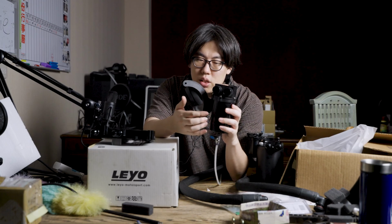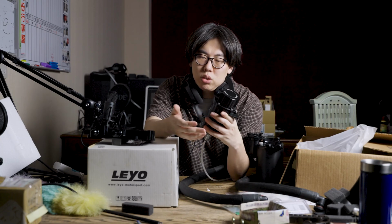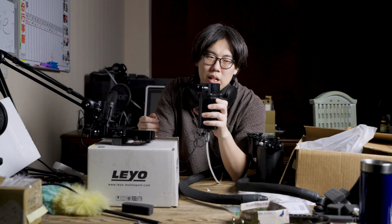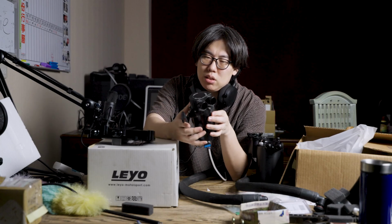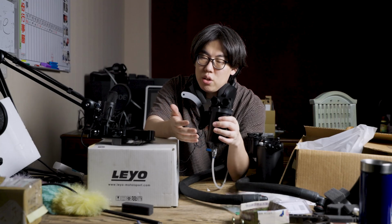But if this catch can is good, why don't manufacturers use it? I think the main reason is it has to be maintained. It's one more thing you have to do on your service, and most people just don't bother. They feel okay with the dirty air going into the intake manifold. It's not going to damage your engine right away. In the long term, it's obviously going to cause some damage, like carbon buildup. But it's just not that serious unless you really want to take care of your car, you're preparing to keep it a long time, and you don't mind doing some extra steps. It's good.